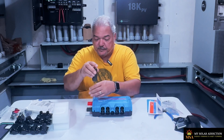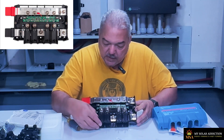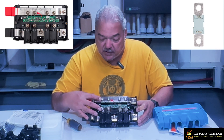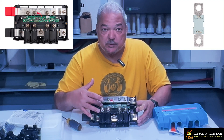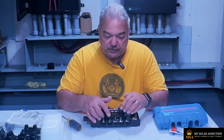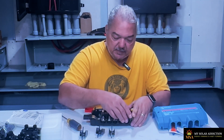I'm getting my trusty screwdriver out to pull the cover off. And there we can see the inside. We have these spacers, these lugs, these terminals. You'd put a fuse between these two terminals connecting where the cable comes in from the battery — the positive through the fuse, because you want to have a fused positive, then to the positive bus bar. The same thing here and as you go down. You would put your negatives on the bottom terminals. These come off — it's not a big deal to pull them off, they'll snap right back in. I'm going to pull them all off so we can see.